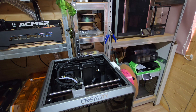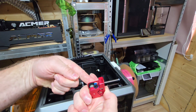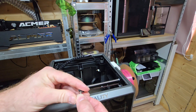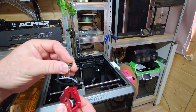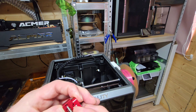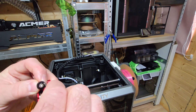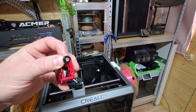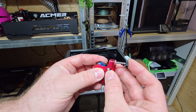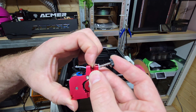The idea is to take the spring out and fit that in first. It's going to be in this orientation — the motor going in from the back and this facing the front of the filament head. You want to put the spring on like so, just fits over. Make sure you do that from the beginning. Before you put the handle and spring on, make sure it's connected up to the actual motor, because inside here there's a part where we need to connect it to the extruder motor.